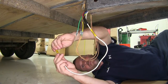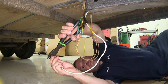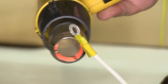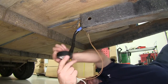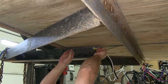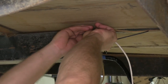For our ground wire to connect it to the vehicle's frame, we're going to use the DECA ring terminal in the heat shrink design in the yellow color. Now that our other butt connectors have cooled down, we'll tape our wires to give them a little more protection. We'll then take our ground wire with the ring terminal, add it to the ground stud, and tighten the nut back down.